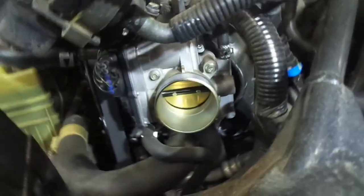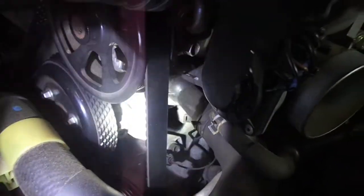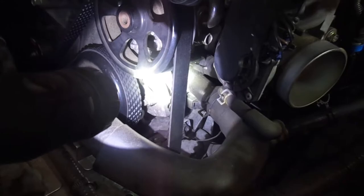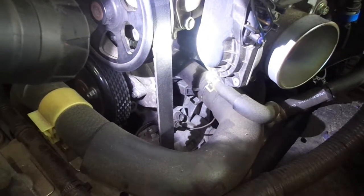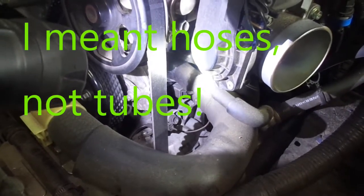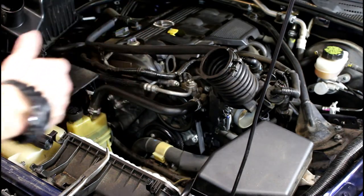There's the throttle body. Just below it is the thermostat — there's a smaller tube and a larger tube right above it. You can see the plastic extension with one spring clamp and another spring clamp. Grab those clamps with a pair of pliers, press the tabs together, and slide the clamps away from the engine toward you — the tubes will come off. Thanks for all the new subscribers — if you think I could do something better please let me know, hit the like button, and subscribe.